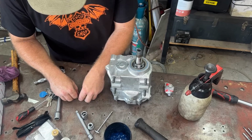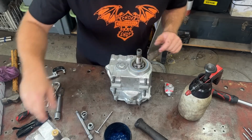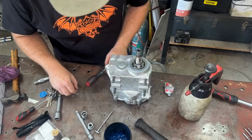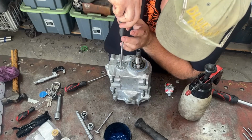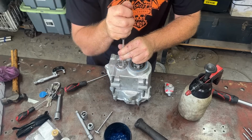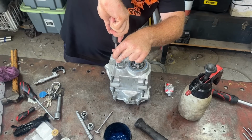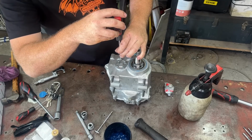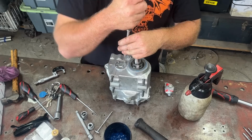So that on there, and then they got these tiny little screws. So when I smeared all that glue on there, I got a bit in all the holes. So the holes go all the way through just to be annoying. So they will be all sorted. They will have a little bit of sealing going on. Let's go around, tighten all these up. A later box won't have this either. Later box, they sort of didn't worry about it. I suppose there's more holes they got to drill in all the case and everything, and another piece. Later boxes are just an O-ring that is supposed to stop it. So if you've got a later box, just cover the outside in goo to stop it from leaking. These things aren't real great, are they?